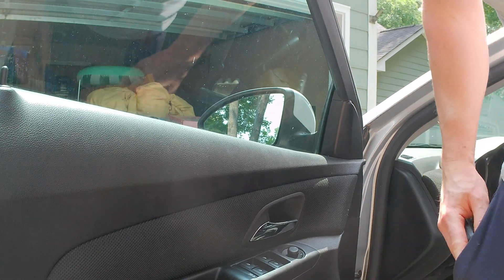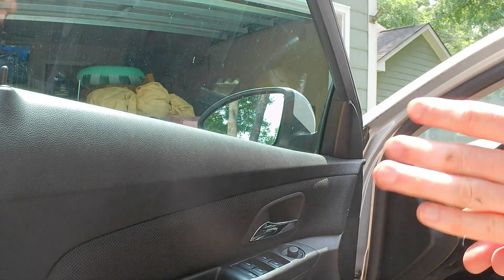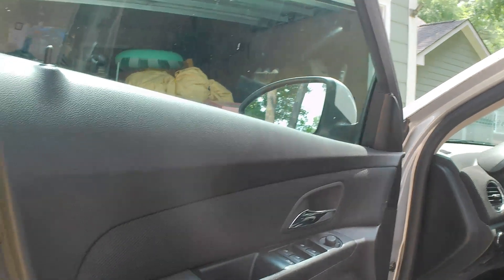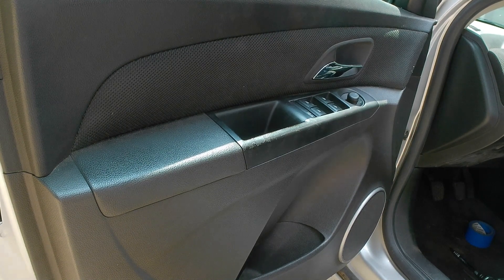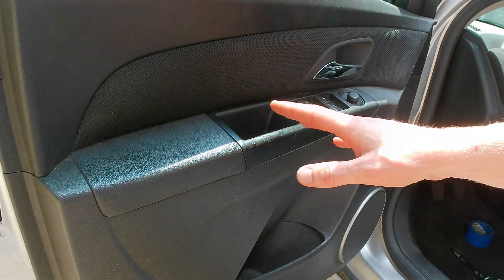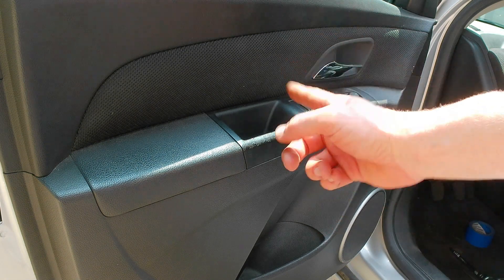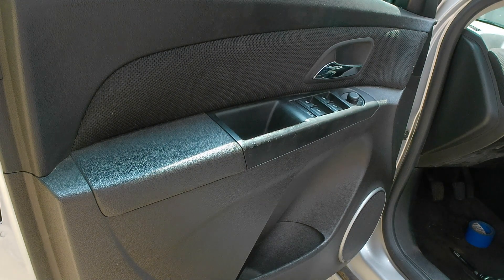Put your key in — and there you go, she goes down and goes up. I'm not exactly sure how long this took, but aside from that little pause when I found the broken piece in the door, it took maybe 15 minutes start to finish. It's really not that difficult of a job — the hardest part is dealing with that liner if you want to keep it. Remember to check and make sure you get the correct regulator for your window: check if it has the auto up and down, and if you're replacing the regulator you might as well replace the motor at the same time. That's how you change out a window regulator on a first-gen Cruze. Like, comment, subscribe — thanks for watching.